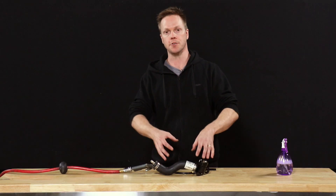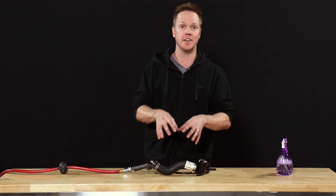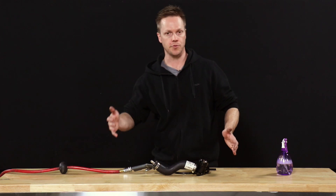One of the things about a leak test is you're actually putting boost pressure into the turbo intake. Normally when the car is on boost, boost pressure isn't on the turbo intake. In fact there is no pressure at the turbo intake itself — it is only from the turbo to the intake manifold.